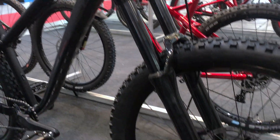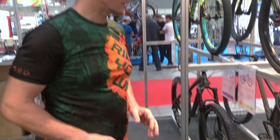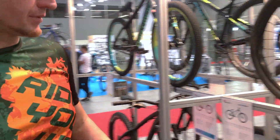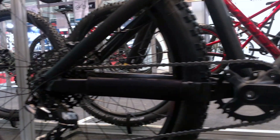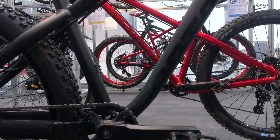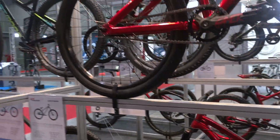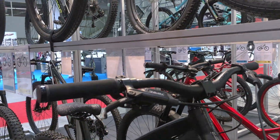It has a very strong, simple RST Storm fork — not sophisticated, but strong. We have a 10-speed drivetrain with a Sunrace 1142 cassette. We still have the two-piece crankset for mass production. We have the 780-millimeter Tornado handlebar with our Fury stem, and our new Cruiser aftermarket rim — 35 millimeters wide, perfect for wide tires. The tire here will be 27.5 by 2.5.